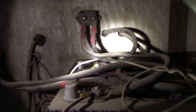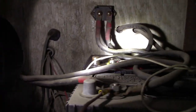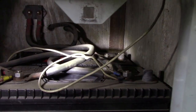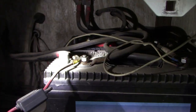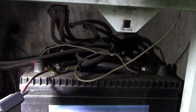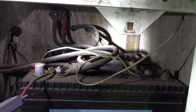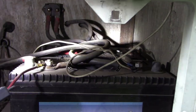Let me see if we can see that. Can you see that back battery? See the terminal's pretty crusty — the whole battery's wet. That's weird. This battery here in front is just dry, no crusties. But that one back there doesn't look very good. This is the exact same setup that most of you will have on your RV — you're going to have two coach batteries, and if you've got a diesel coach, you've got at least two chassis batteries. I cannot get to the top of those batteries well enough to put water in them, so I actually have to pull those batteries out.